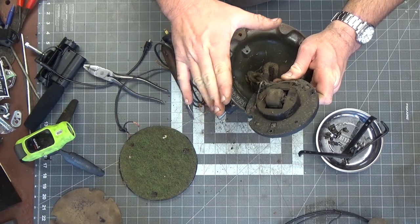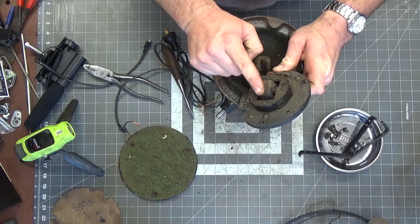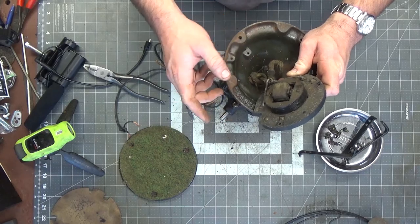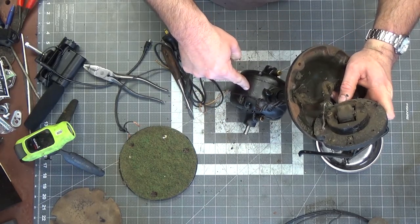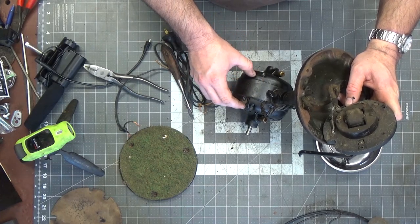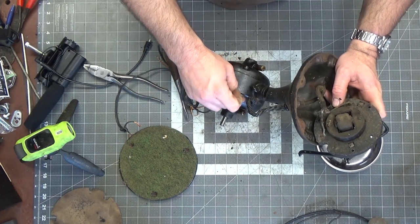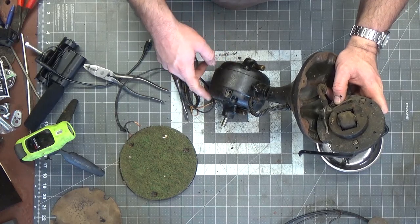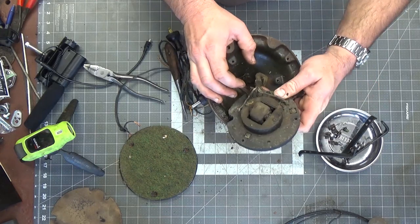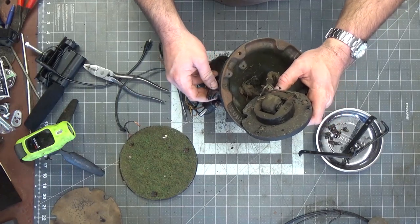From my research, this leads me to believe this fan is an in-between year. The choke coil is an older method of controlling speed. If you had gone to a later year when they started to change the windings in the head, there would have been a different number of windings energized to give you different speeds. So two of these wires are doing nothing, which is going to be interesting.